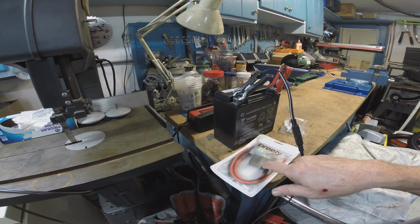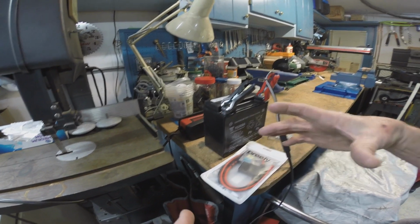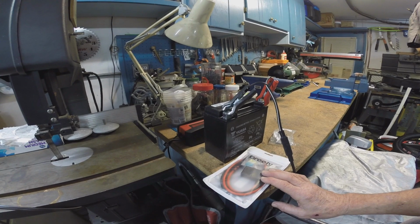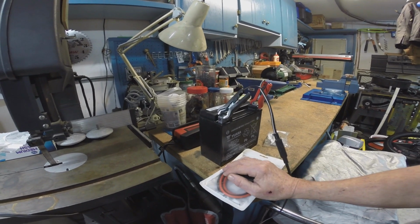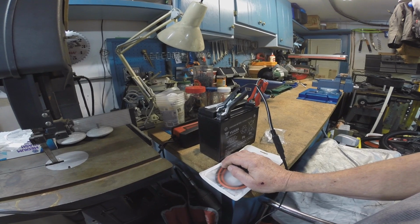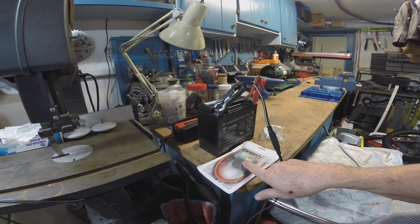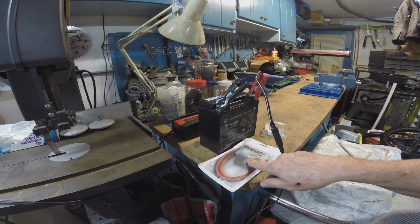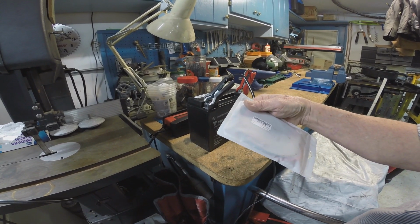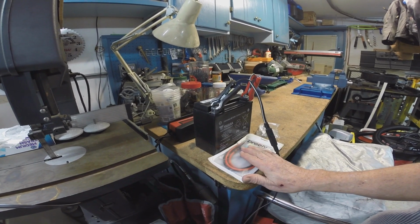And that's one of the projects that I want to do. But I want to be able to jump through my charging plug with my little square jump box. I've never been stranded by a dead battery out. My brother did, and thankfully I had the jump box, although we had to take practically everything down to the battery on his Indian Chieftain to jump that thing, and that's a pain. So it'd be nice if you could do it right off of the charging. So I made some of these and we put them on our Indians, and they work real well. This one I bought already pre-made up by iGreeley, an Amazon.com purchase, made in China, of course. And it's 10 gauge siliconized wire. So we're going to go ahead and put that on there too.